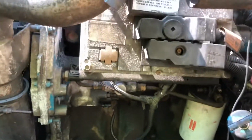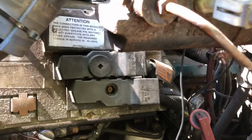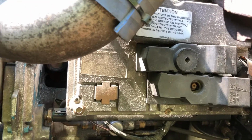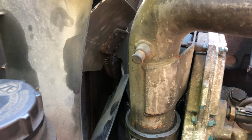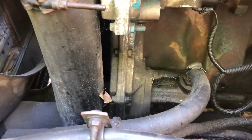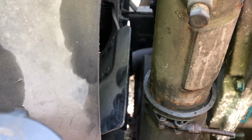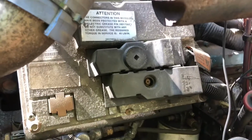But to know if the oil pump is okay or not, the oil pump for this one will cost you around $700 at the dealer. So before doing a big job to replace that one, you have to remove all the fan, the cover, the hoses, the coolant reservoir, everything here. Also the lower motor mounts, the flat mounts, the harmonic balancer and the middle one, and then the timing belt cover. It's a lot of work. So you have to make sure if there is a problem with the oil pump.